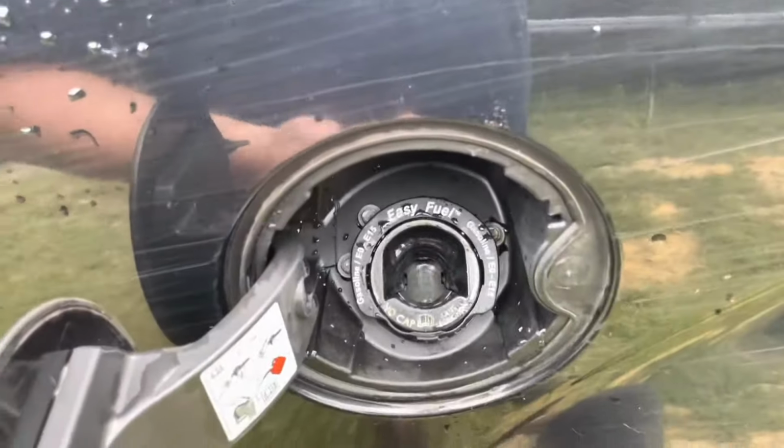Now you're looking at a check engine light, and you possibly have the message to check your fuel fill inlet. So all I'm going to do is work that inlet back and forth, clean it, WD-40, PB Blaster, some Seafoam injector cleaner. You're not putting a bunch in there. You're just putting it around the outside, work that gate to your fuel inlet tank itself back and forth, clean it, and I'm going to take a rag, something microfiber. I'm going to clean all that off so that the lubricant that you put on there doesn't collect more trash.